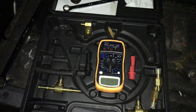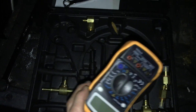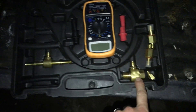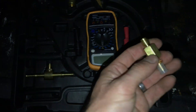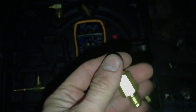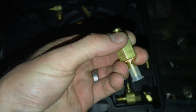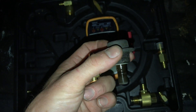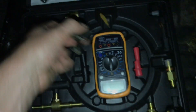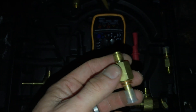Here's the set from O'Reilly's — they included a multimeter but with no cables, so it's kind of pointless. It comes with different fittings; the fitting I'm using looks just like this. The banjo style goes down, and basically what you're doing is replacing this fuel dampener right out of the banjo bolt area. I use a 7/8 wrench for that.